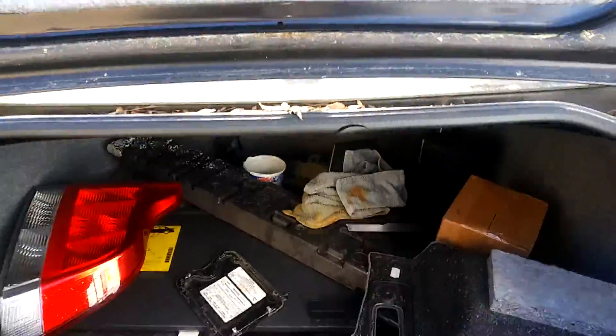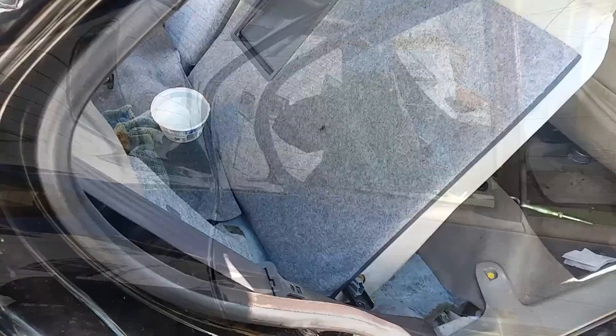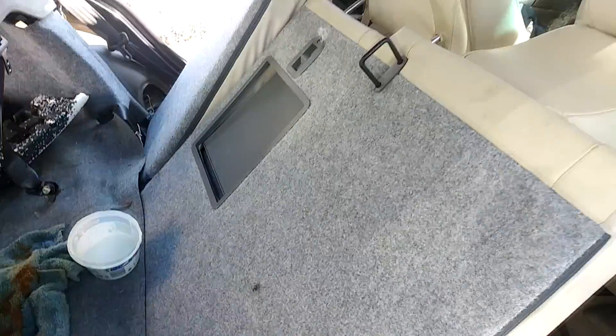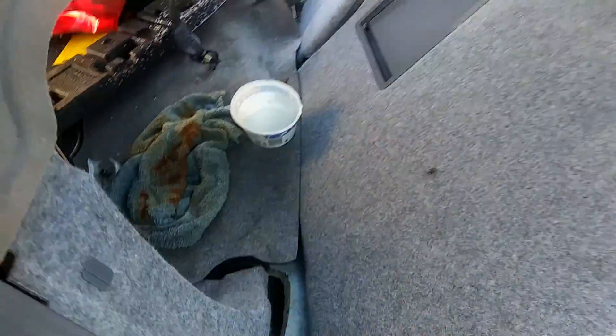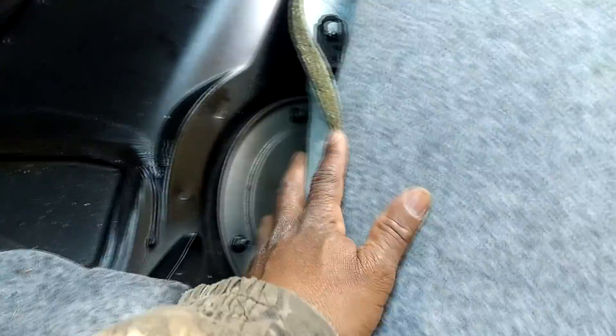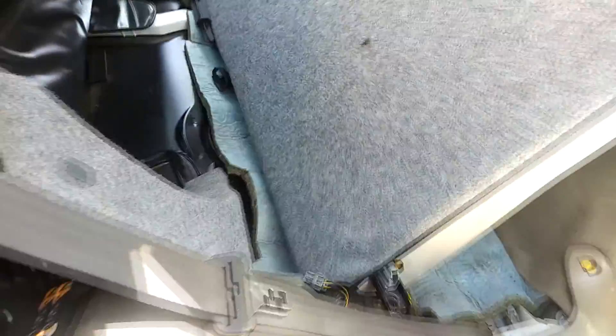Go on the inside. Lift this side up and turn it out as well. What's going to happen is your seats are going to fall forward, like this — on the passenger side. Lift up this floor panel and you got a silver cap. Let me get this out of the way so I can show you where the fuel pump is.